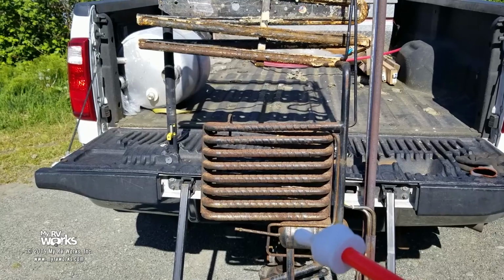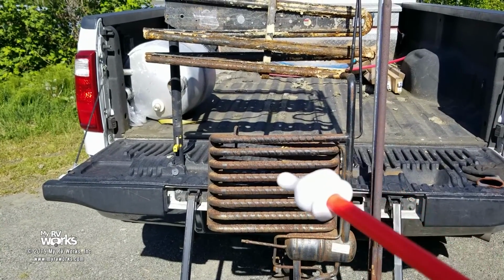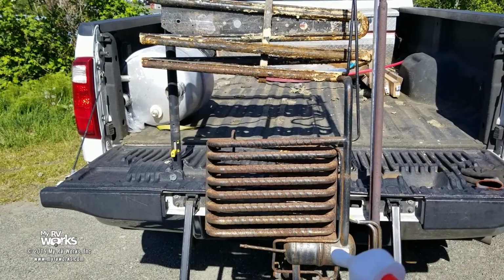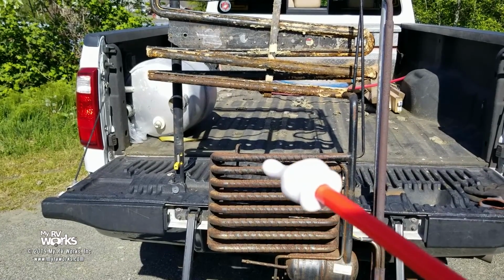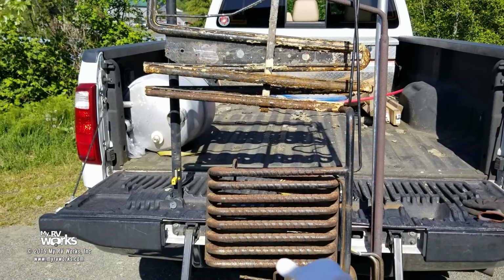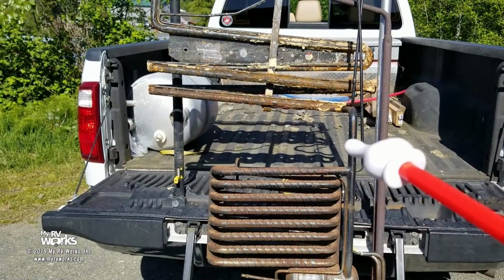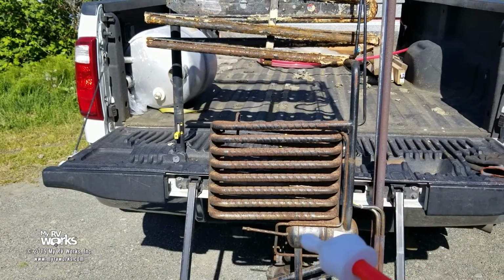And then the vapor is going to start working its way back up, backward style, through this. The ammonia and the hydrogen vapor is working its way backwards up this like a smokestack, as a vapor going back up. Again, it's been heated. It needs to get rid of all that heat that it absorbed. So now we're a vapor going back into this vessel.